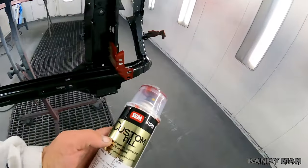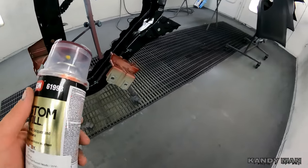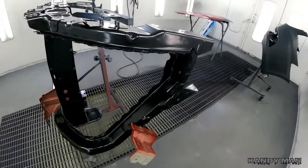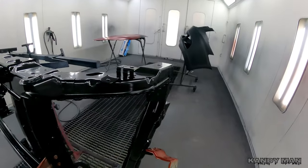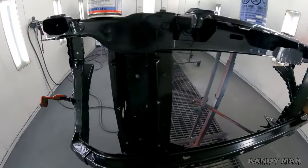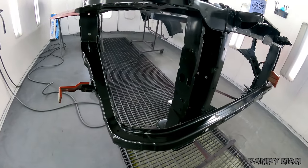And then you can use these base coats in the cans. These are the factory color they mix, and you hit your spots where they weld it up. So I'm shooting this with another job in here right now. That way I kill two birds with one stone with my sealer and the clear when I dust it to make sure that it's good. So we're gonna shoot this one. We've got to make this thing like a beige green and then dust it with the red to make it look factory.